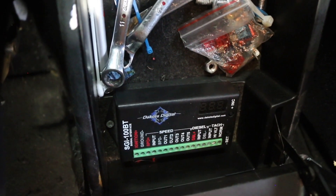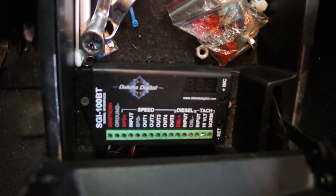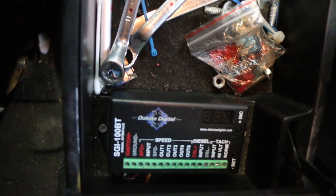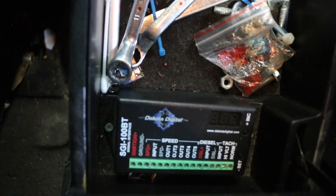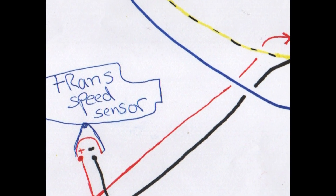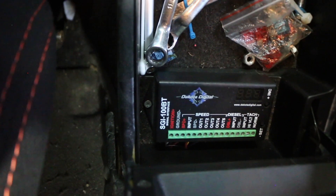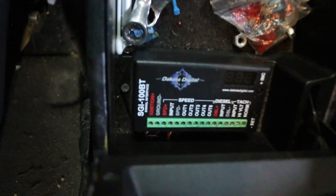That speed positive is not going to get connected — that red one you see there gets nothing. Your input: I got mine directly from the positive output, or the signal wire, from my speed sensor. Make sure wherever you got it — if you're using a T56, I believe it's the pin on the left-hand side when you're facing the sensor going into the transmission. You want to make sure you get the positive wire from the speed sensor and have that go directly to the input.